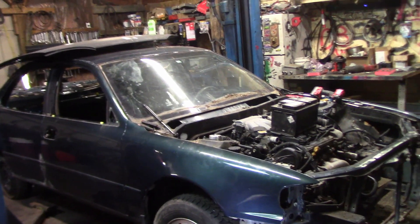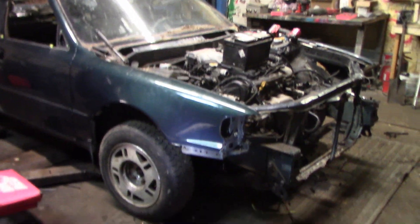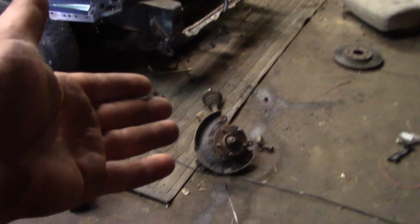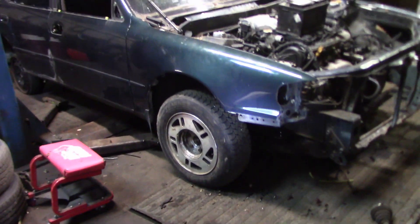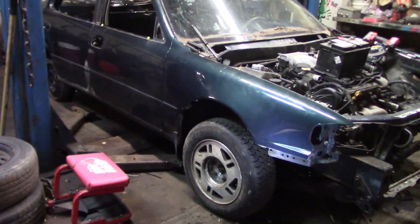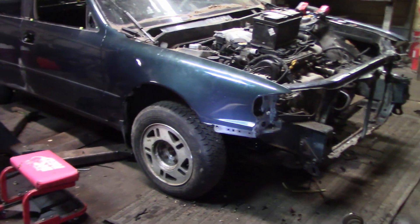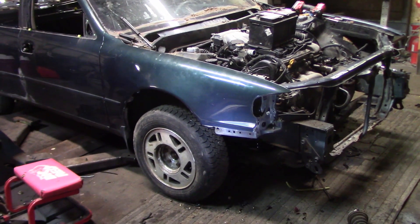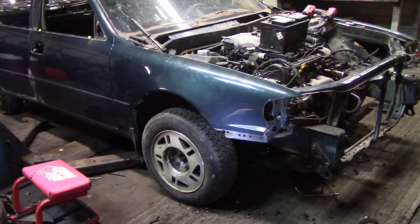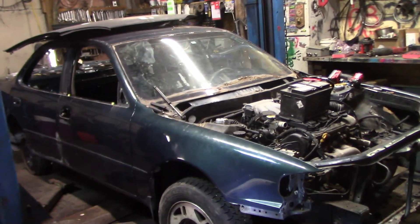We are just going to have fun with it pretty much. Thanks for watching everybody — we got the front brakes all done, we got 14s on it now instead of the factory 15s. The rules say I can't swap spindles, and realistically I did not swap the spindles — I just swapped the calipers and the discs. That's it. No modifications, no spindle swapping at all, just simple brakes. The only advantage this gives me is I can run smaller rims, and the reason I want smaller rims is because all my doubles are 14s, not 15s. Thanks for watching everybody, and we will see you back here on Zach's Workshop.